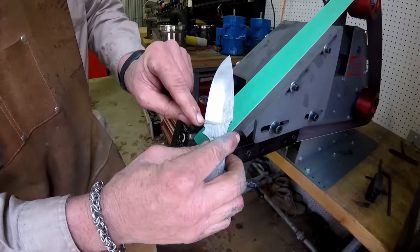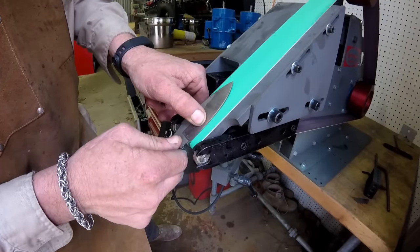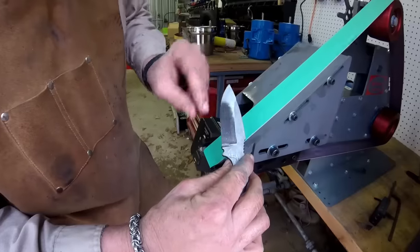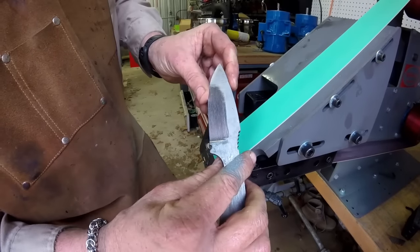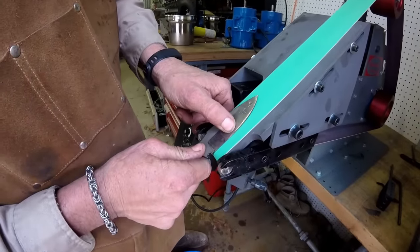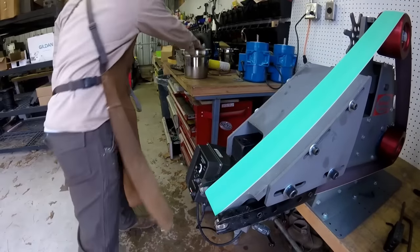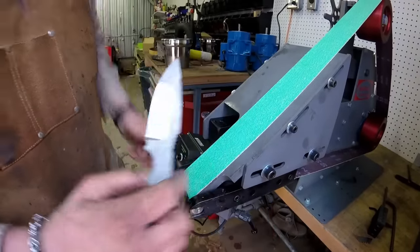You guys can see we're starting to clean it up and it's starting to create the new plunge. It's starting to look nice. We've got to move back a little bit more. I'm starting to get all the scratches going in the right direction. It's a nice plunge already but it's got to move further back. I could have put the original plunge a little further to the rear — I had it about three-sixteenths forward, it probably should have been a little further to the rear.